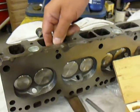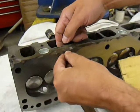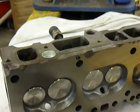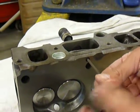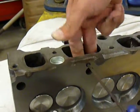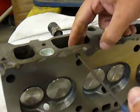The next step is you'll take your cap screw, insert it through the hole that you've made, and you're able to actually screw your lump in. You don't have to brutally torque these down — they hold really well. One bolt is all it takes. You'll reach in the port and make sure it's lined up, centered on the back side, inside your ports.